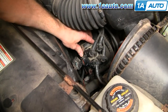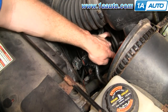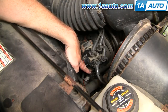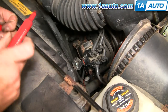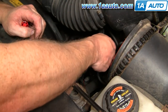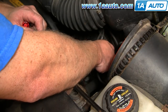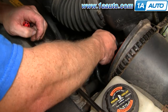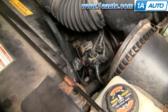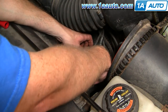I've run into a little bit of a problem here. You can see that these two bolts came out, and actually my third bolt is out too. But this fourth bolt — the head was so rusty it actually stripped. So what I'm going to do is take a marker and mark the plug wires starting with the one closest to me. I'll mark that as one, two, three — so the one without marks is the fourth one. That way I know number one started closest to me and then clockwise around.